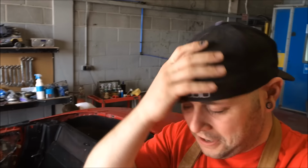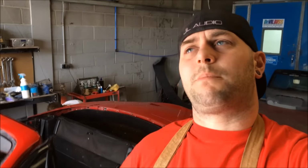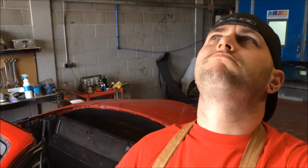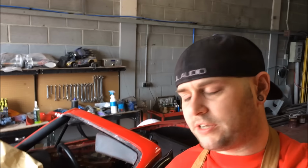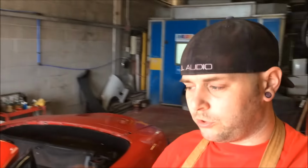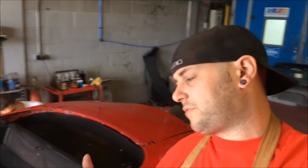So I thought, right, we need to go with a tough clear coat, and it needs to be tough within a week or so, because obviously clear coats take a while to cure. So we went with the VOC, because it may not be as pure, should we say, as liquid glass regarding clarity, but regarding durability, the VOC wins it, hands down. It's a true HS clear. You will not get a stone chip with this. No way. So anyway, that's enough talking.